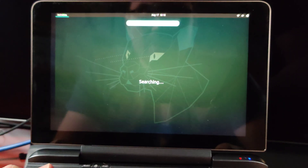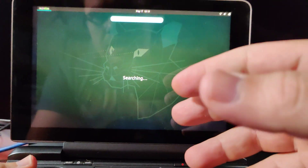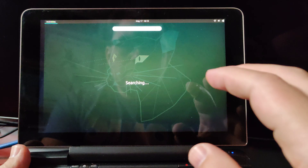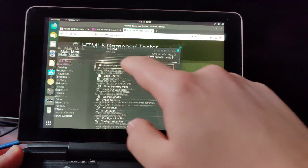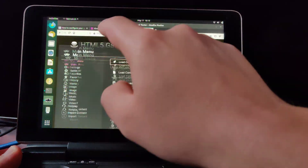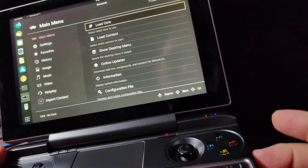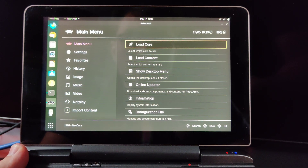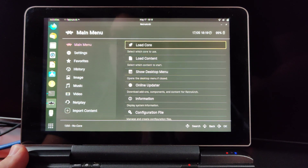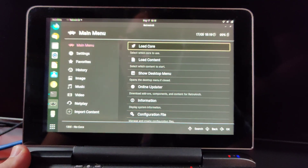The main problem right here is that we have to make sure the main display is working correctly, working as it should. Because as far as I can see, most everything does work just fine — even the touch, which normally never works. Usually the offset is way off, but this is working as it should. RJ45 is working at gigabit. Literally everything is working. I haven't tested Thunderbolt 3 with a GPU, but it does detect it, and when we go into settings it shows that it's available. I'd wager that it does work just fine.